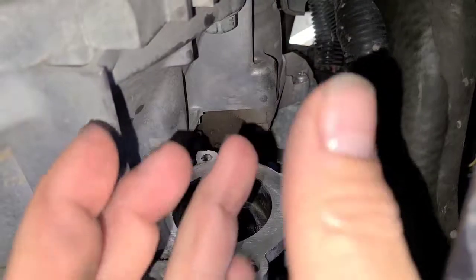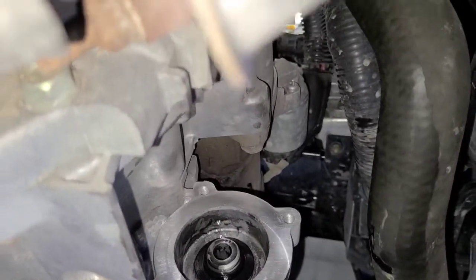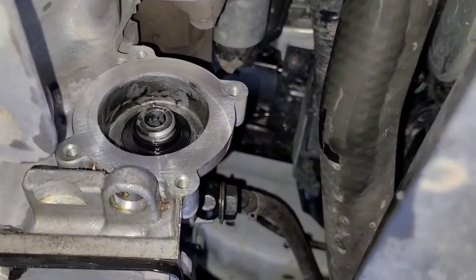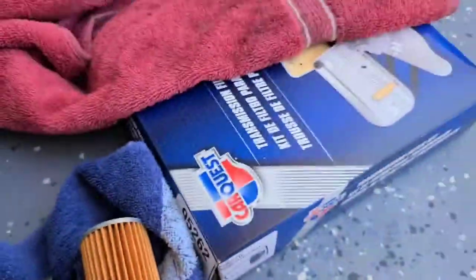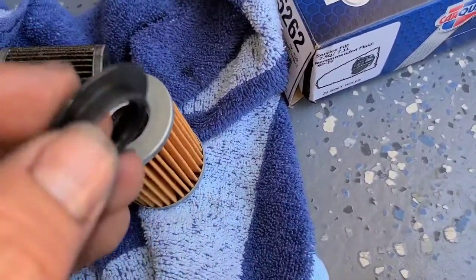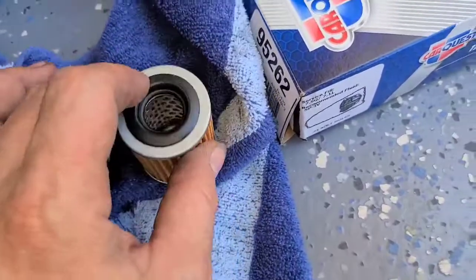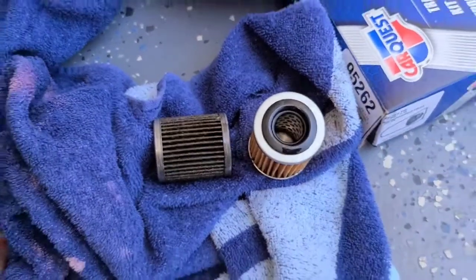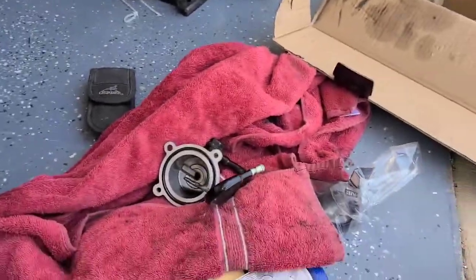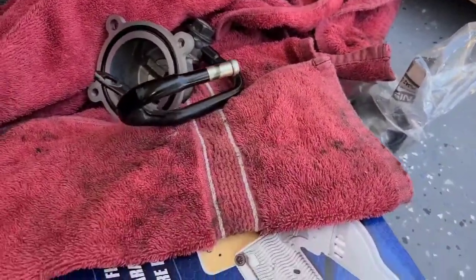You'll have to kind of pull down on it a little bit and kind of work the line and bracket over the top here and pull it down - it'll come off. Then you should be able to pull the filter out and make sure you take the old gasket off, then replace it with the new one. The new one comes with a gasket. If the gasket is not inserted, just make sure that the end with the lip goes down into the gasket so it's gonna sit like that going into the transmission. That'll be your cooler return line filter. Some CVT transmissions don't have the same type of setup - this one runs to a cooler in the radiator.